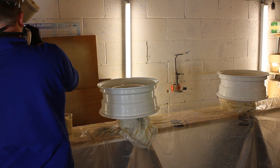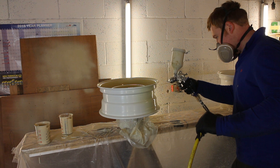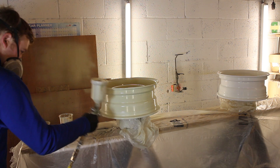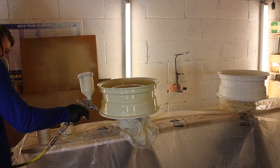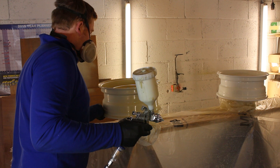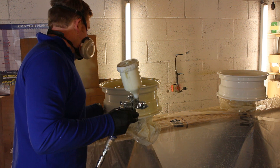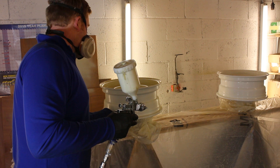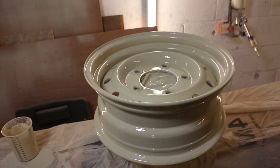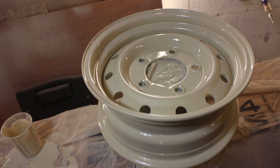This is just a thin coat first; we'll add a medium wet coat after this coat has flashed off. Between coats I'm using a space heater to bring up ambient temperature — most paints should be applied above 5–8 degrees, ideally at 20 degrees; I've managed to get the workshop up to 15, which is much better. This stops it blooming and gives a good finish. I can turn the wheel using my paint can without having to move around. I'm releasing the trigger at the end of each pass to keep pressure in the gun consistent. The paint finish is flawless — not a single piece of debris or dirt — and I'll leave them to cure for a couple of weeks before taking them to a wheel fitting place.